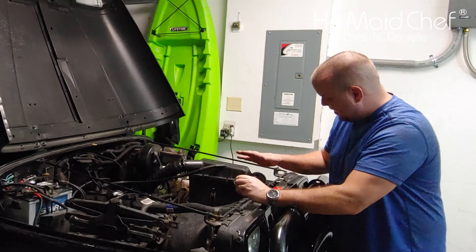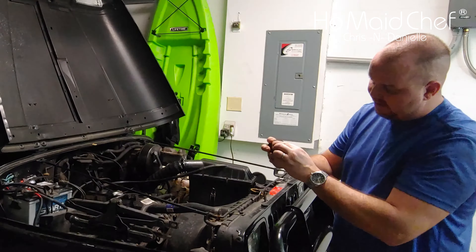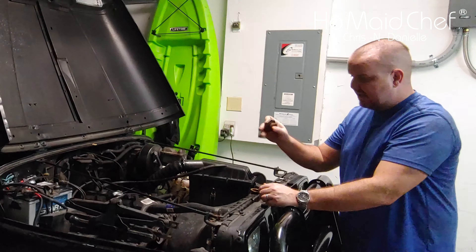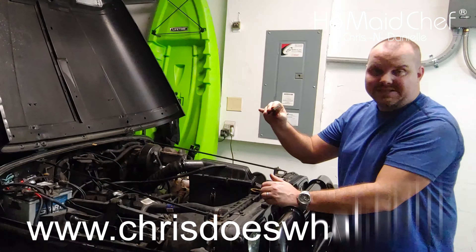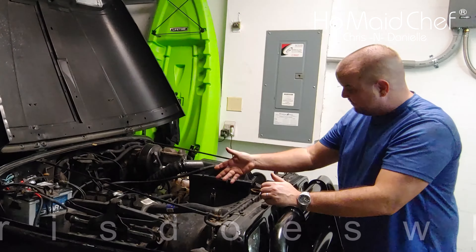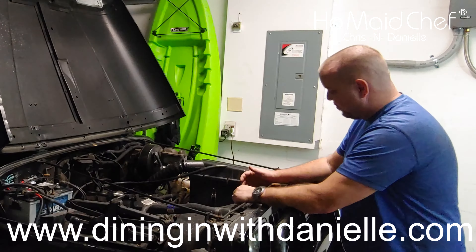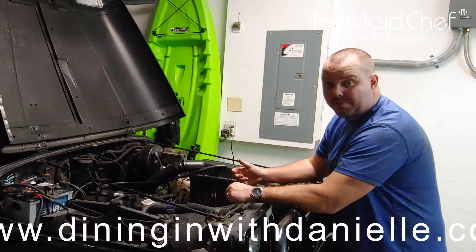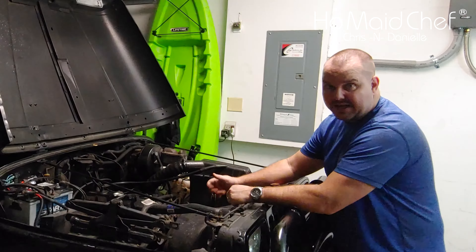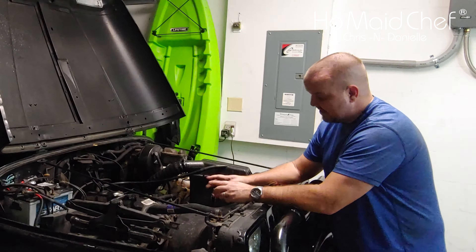The first thing we did was check the radiator cap since it was such a small leak — the rubber felt malleable and wasn't cracked, and the spring is at about 16 pounds of tension, so that's good. After a while we noticed rust on here because the previous owner filled the radiator with plain water. We have rust on the front of the engine, and I'm really hoping this is a weep hole on the back of the water pump and not anything more serious.